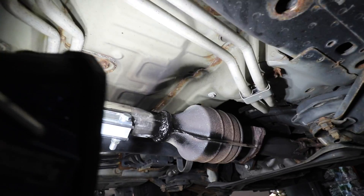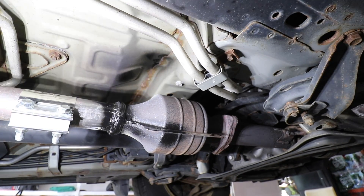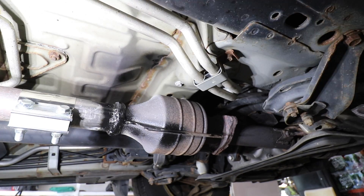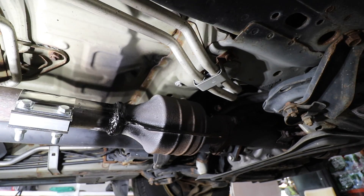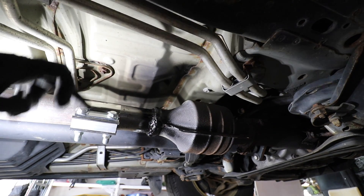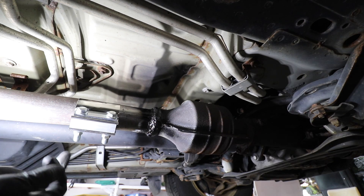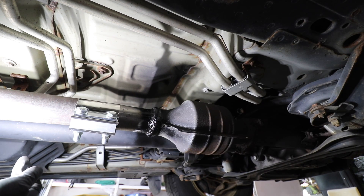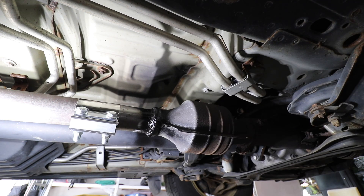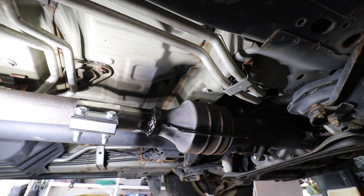There is the exhaust clamp, and I also added a little bit of high temperature spray paint to where we welded that new little stubby shaft onto the cat — everything looks real good. With that, I'm going to conclude this video. If you're curious where to find these exhaust butt clamps, I'll leave links in the description below. When you buy these, ensure they are sized appropriately for the exhaust pipe you plan to use them on. Thanks for watching — I'll catch you on the next one.